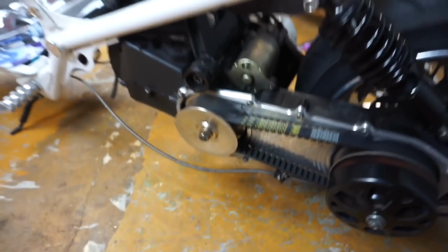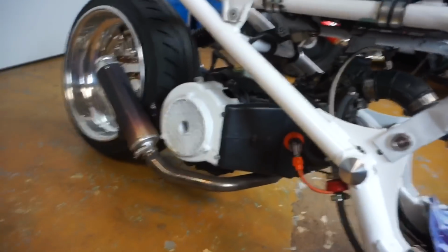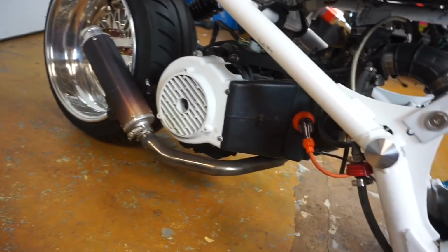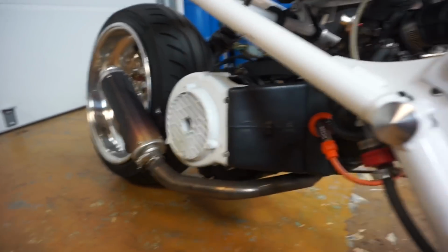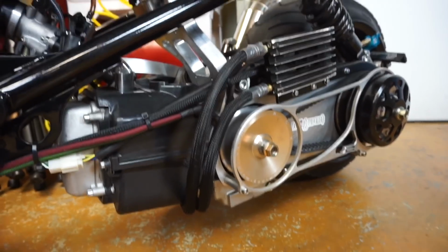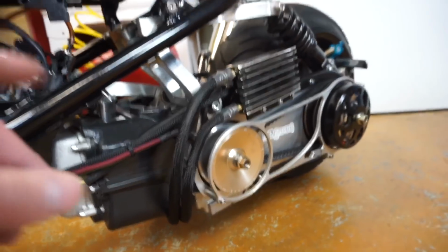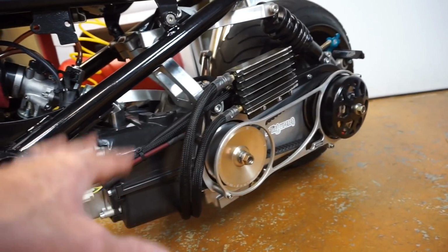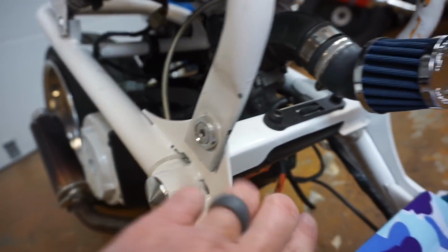So I've got one of these 157 QMJ, and again, that plate is right here. Difficult to read. They make two versions of this GY6 engine. This here is a GY6A motor. These are fairly cheap to get, around $400 or $500. You can get a brand new GY6A motor that's made in China. Or you have the GY6B motor, which is found in a lot of the Kimcos, Genuines, but it's made in Taiwan. The two differences is purely quality. The quality is much better on the B motor. Taiwanese quality is always better than Chinese quality. But the biggest difference is the stud spacing on the cylinder there.